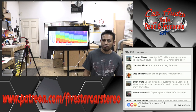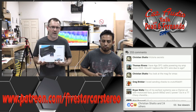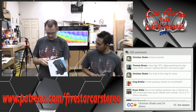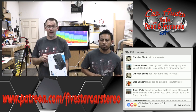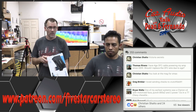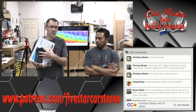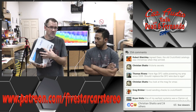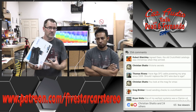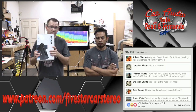This little guy right here — this is a Forza 8-channel DSP amplifier. It's 85 by 8 at 4 ohm, 150 by 8 at 2 ohm. It's got an 8.1-channel DSP — 8 channels as well as one output for a subwoofer. Estimated retail price on this guy is $1,500.